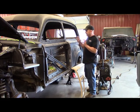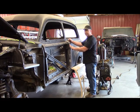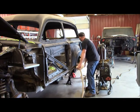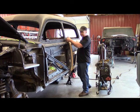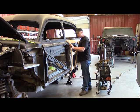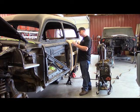Now I got the latches all done and they're in place, and the door is latching and closing. I've got the strike out right at the moment. But I've been working on your wood some more. So I've worked on this, and I put a little piece of 80 grit and cleaned this off and put it all the way down the face of that. And then I took this wood and just gently moved it back and forth. And it put a scratch onto the face of this, and it shows me where to cut that. So I've done that, and it's been off and on, off and on, off and on.